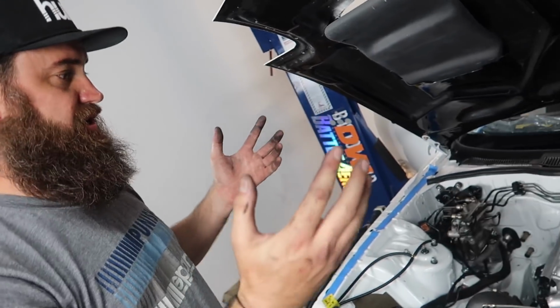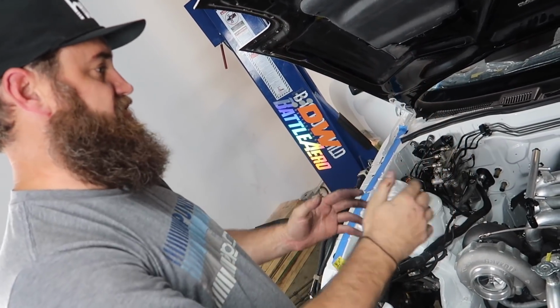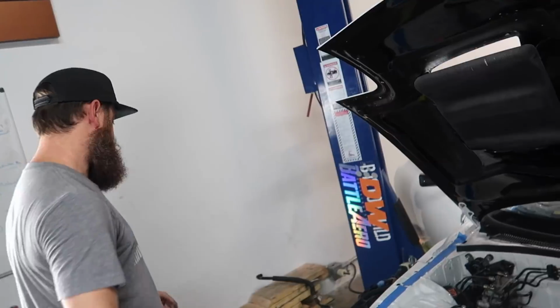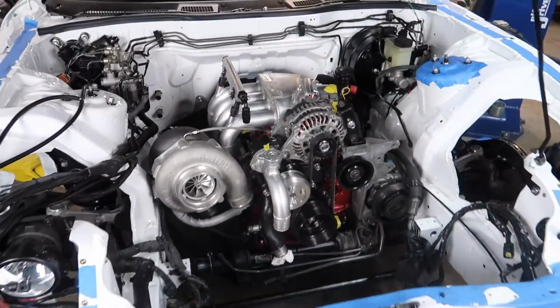So what we're gonna do is put the car up, and we wanna get some measurements off of the oil pan and the bottom of the engine, which is actually square to the frame rails, and get this thing sitting in there just right, and then we'll tighten all the bolts down. So you wanna go up? Damn, that's exciting, baby! Made big steps today, big improvements.